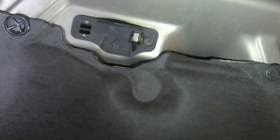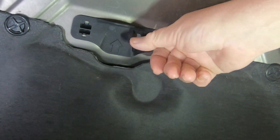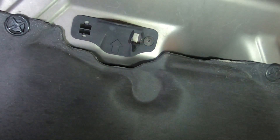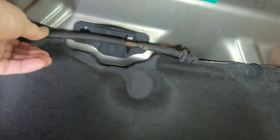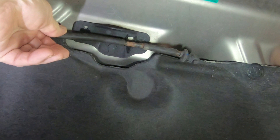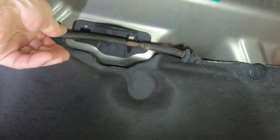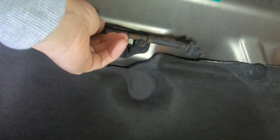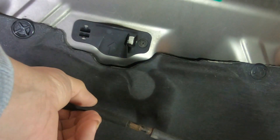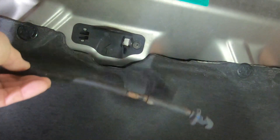The problem is this little device here. It's a little plastic retaining device and it's supposed to have a little hook on it that holds the rod in place. You see it goes about there and the little hook is broken off. Now how it's supposed to work is when you want to remove the rod to use it, you put your thumb here and you pull it straight out and then down. What people do who don't know any better is they just pull it straight down and bust off the little hook. It's made of plastic, so this hook keeps breaking off.